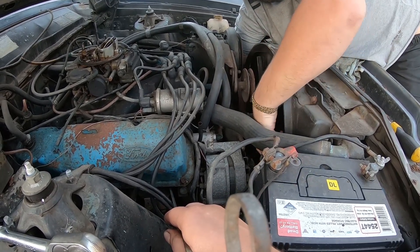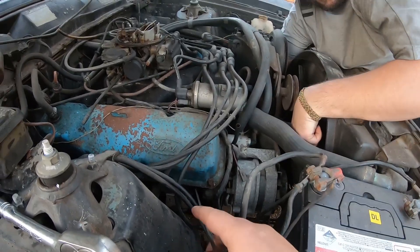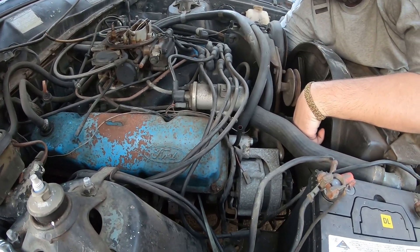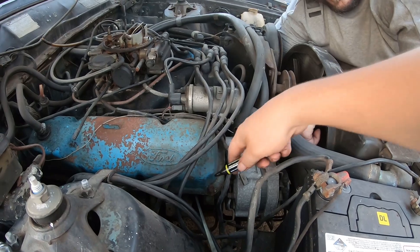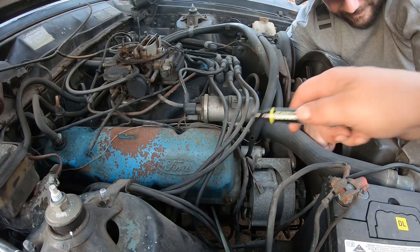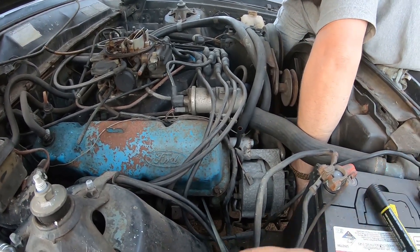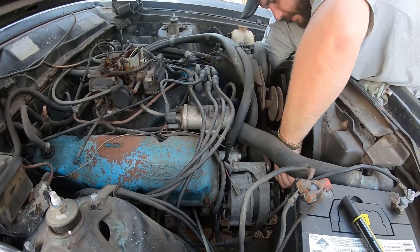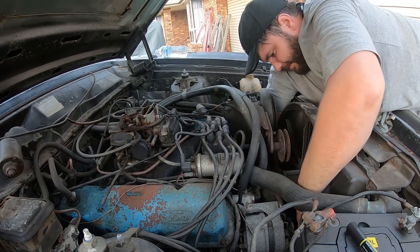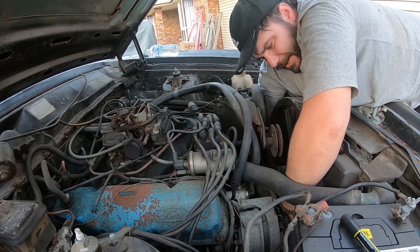It's going back down, so just go forward just a piece — right there. Just to make it easy, I get a permanent marker and mark a known point like this rocker cover rail here — nice stripe right across. Beautiful. Now I just keep spinning the motor. It's at the bottom rock point.